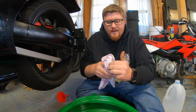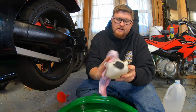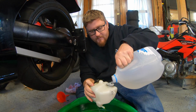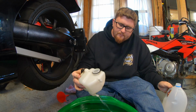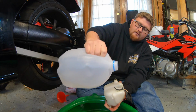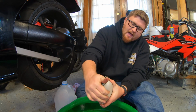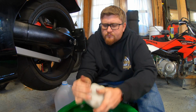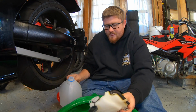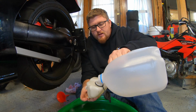Once you dump the contents out, this is a great opportunity. Cover this up. Wipe it down. Get any dirt off, use a rag. Now, this is why I kept some of the distilled water. Fill it up. Drain it out. I'll cap it with my finger. Fill it. Put the cap back on. A good shake. Now, yours might have some dust in it. Yours might be clean. I'd rather be on the safer side and give this a rinse too. You paid for the whole gallon, use it.